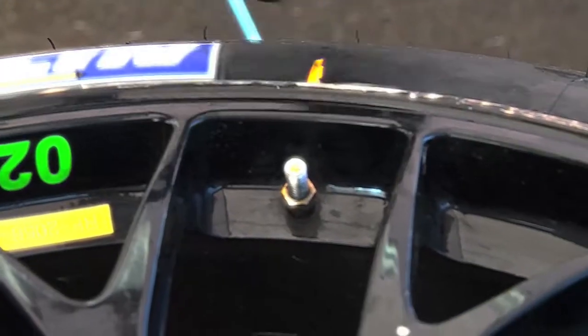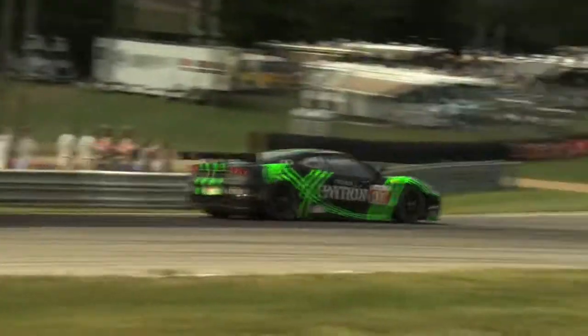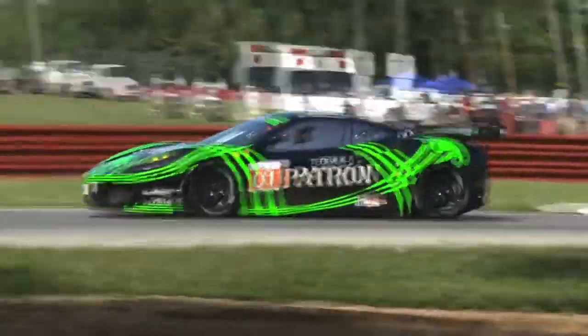Tire pressure sensor — when the car is on the racetrack, these sensors will transmit through the telemetry and we can look at the laptop in pit lane and tell exactly what our tire is doing. They give us a tire temp, they give us our tire pressures. If we have a flat or a tire going down, we know it before the car ever gets back to pit lane.